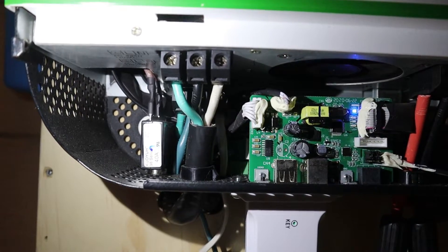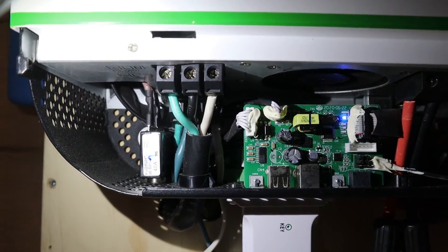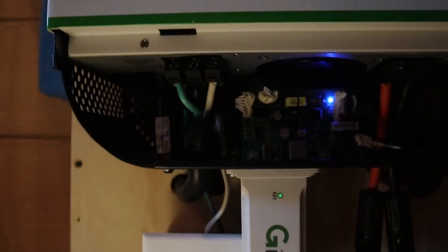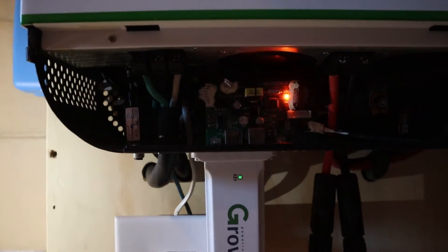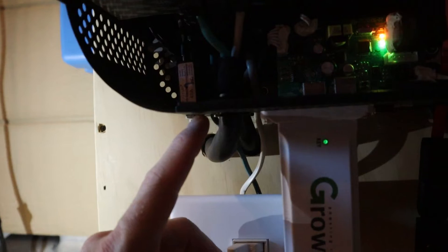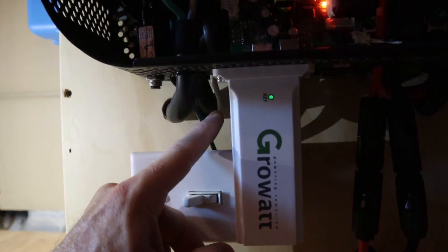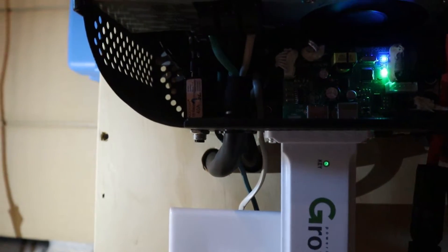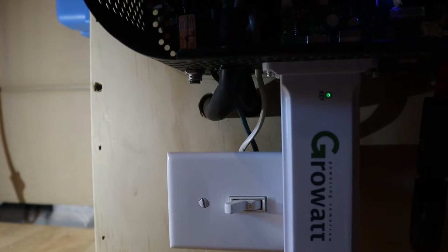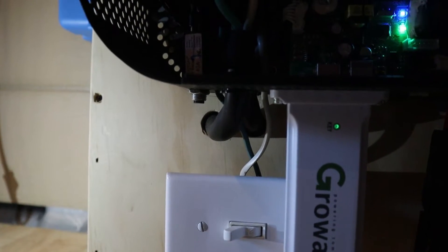And then you will just loop it over to the neutral wire and stick it in that hole, so technically there will be two wires in that same spot. But if you're going to do shore power, you have to run a switch like this. You run your wire from the green ground wire down into the switch, and then I have another white wire going up to the white of the AC output. That creates some kind of feedback path for the wire to ground.